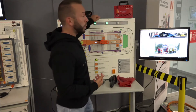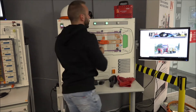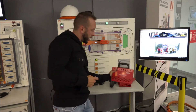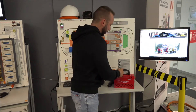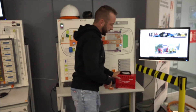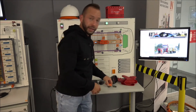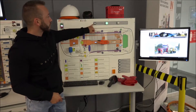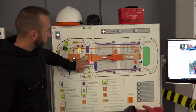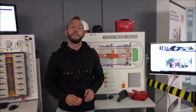We check the car and find a spare key. We don't throw it away — instead we use a lockout box, which is also used inside the workshop. We put the key in the metal housing, wait a few seconds, and there it is: no smart key in range anymore. Now when we shut down the car, no one can put it back into operation.